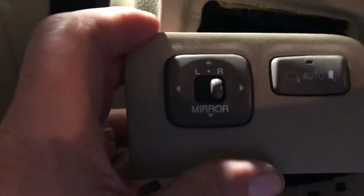But at the point that you bring this out, then you need to remove the wire assemblies from the back. Each of those three plugs in there has a little button on the side. Just look for it carefully, and you are able to push there, and push on the sides, and then just bring out the various wire assemblies. Let me show you what it looks like.